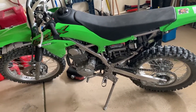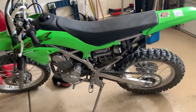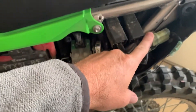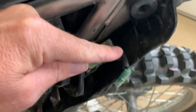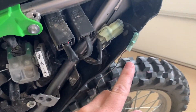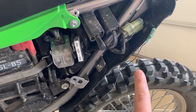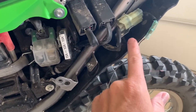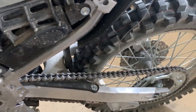So the dealer wanted me to get the code off the bike to see if the same thing happened here. You can't really get a code directly — the check engine light just turns a solid yellow. What he had me do was take off the left side plastic panel. There's a junction right here, and off of it is about a one-inch wire with a female receptacle on it. He said to ground that out and turn the bike on, and then the check engine light should blink with a series of long and short blinks to give the code. I've got it grounded out right now — connected down to the swing arm.